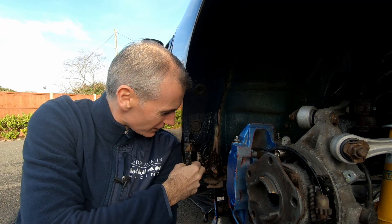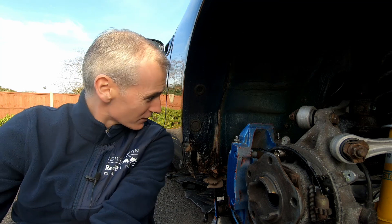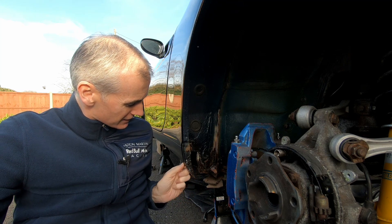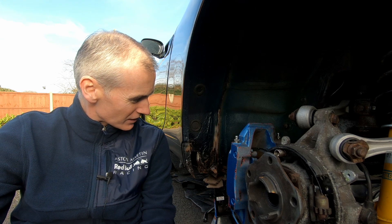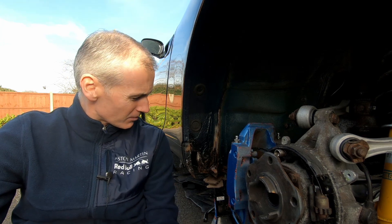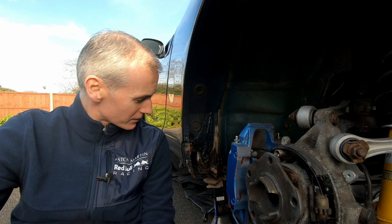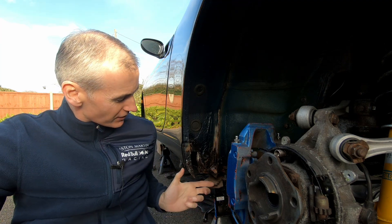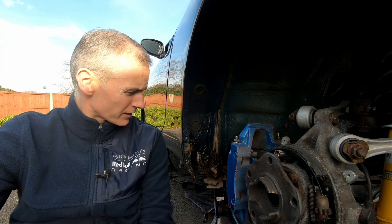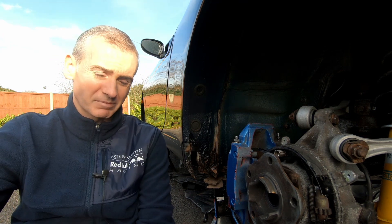Slightly different story out here at the side of the car. I kind of knew there was going to be rust in places, but I don't think I'd appreciated the extent of some of it. It's not the end of the world. It's just a task that I hadn't really factored in time-wise. So I'm going to continue on a lot of the EV componentry for the next little while, so we can then get the car back into the garage and properly weld these things up. If I can get the sheet metal good enough, I'll just replace the flaps with some newer ones off eBay. If that doesn't work and it ends up looking shocking, I'll probably just buy some side skirts and bolt them on — that'll cover up a multitude of sins.